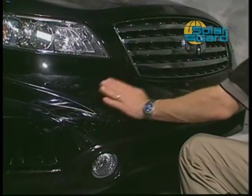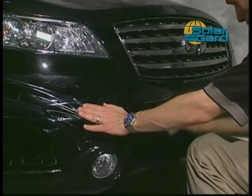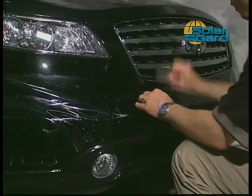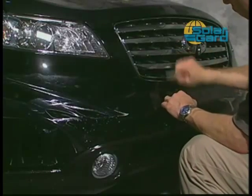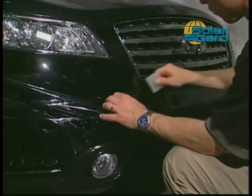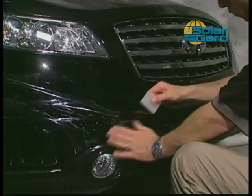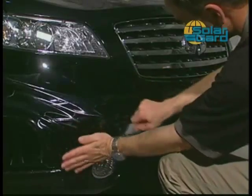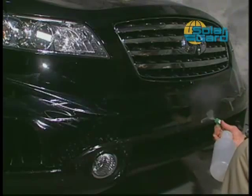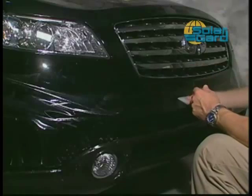Hold the bumper piece up against the vehicle with your hand. This will cause the pattern to take the shape of the curved surface, making the install easier. While pulling, squeegee from the anchored section in the middle of the area of the pattern, just below the headlamp, locking it into place. Force the alcohol solution under the upper and lower edges of the pattern and squeegee in place. This will ensure the bumper pattern is secure and locked down.